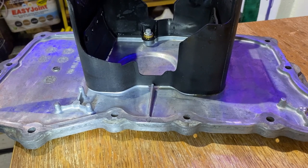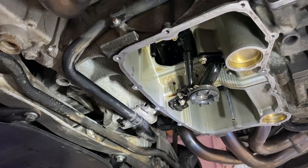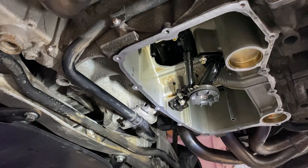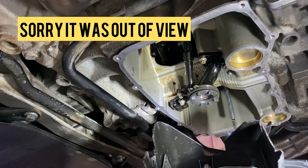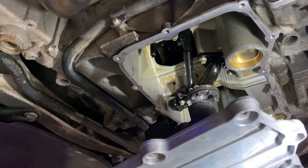After a thorough blasting out with clutch and brake cleaner to make sure there's nothing loose in there — no debris of any kind — I'm going to run a bead of the sealer around the collar and hopefully get it back in the car. You might just be able to make out that I've run my bead of sealant around the sump plate and I am ready.